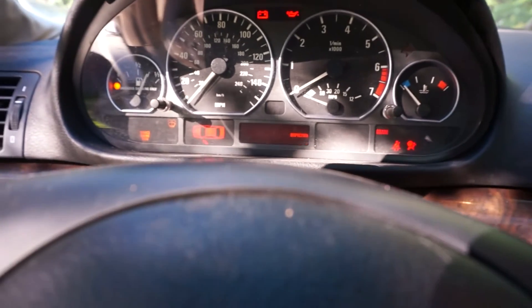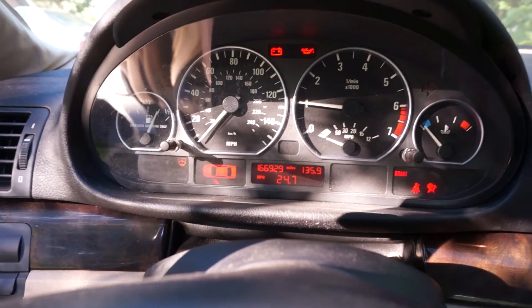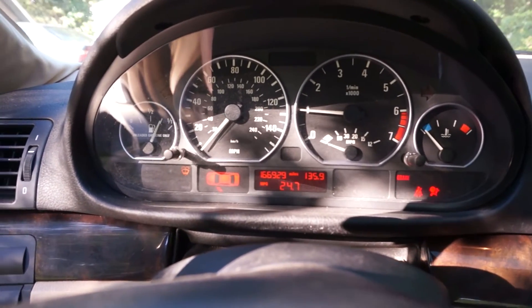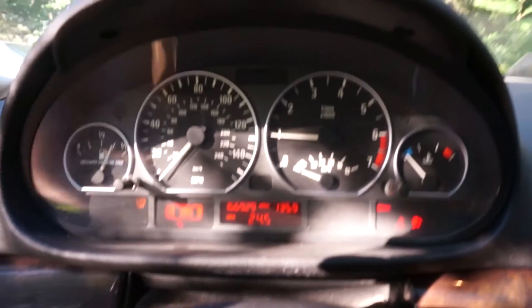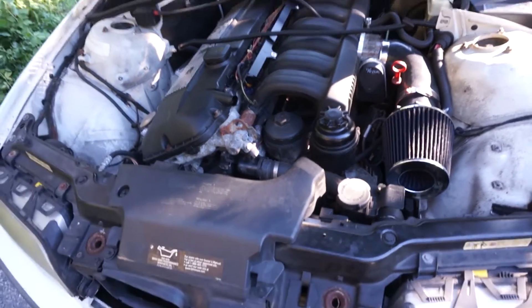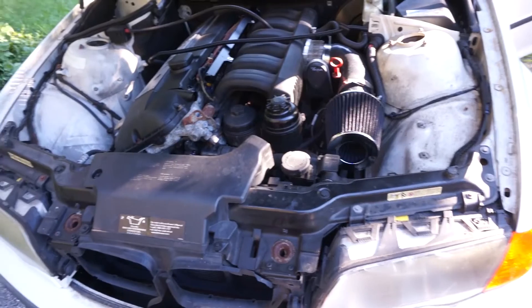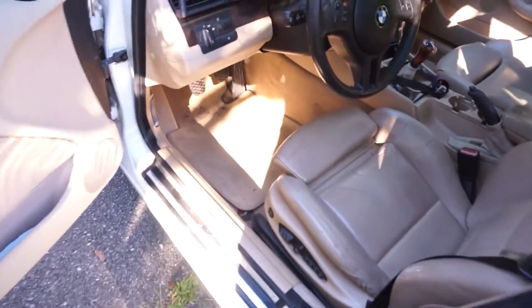The mileage will be accurate once it goes past the inspection — 135.9 miles on it. It's starting better than it normally does because it's on video of course. There's a hint of roughness, and the squeaking is the water pump — it's old and very cheap. I did put a cone air filter on it. The squeaking actually goes away as it warms up. I have another project planned for the cooling system on this car, so I'll just take it around the block real quick and show you how it runs.